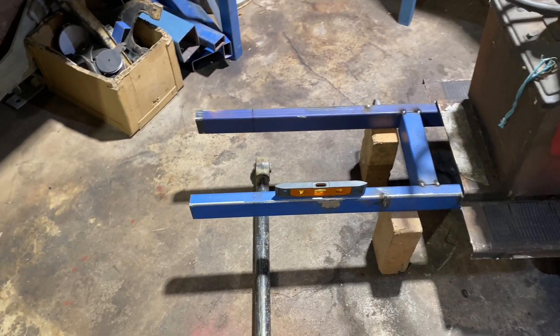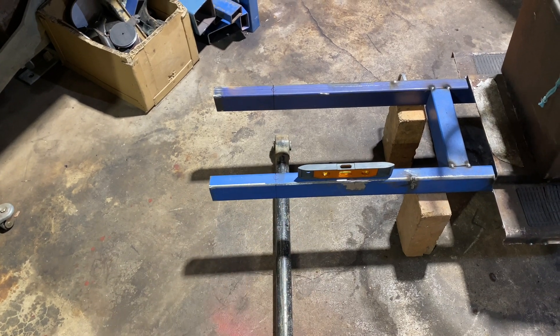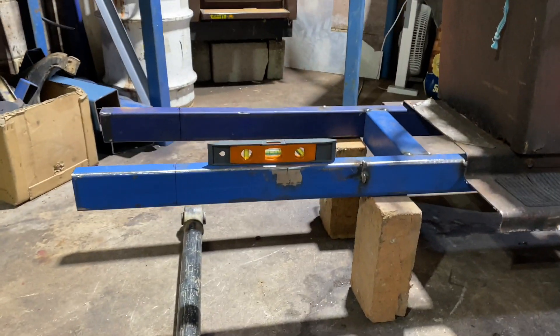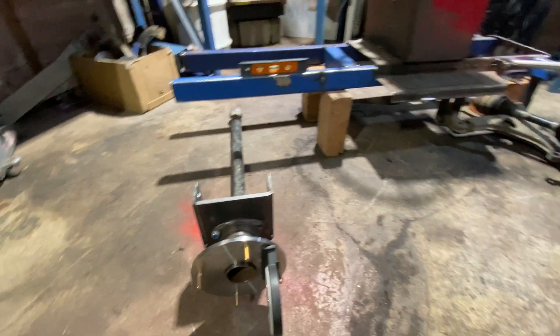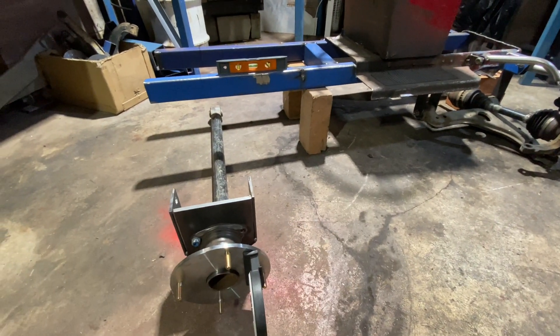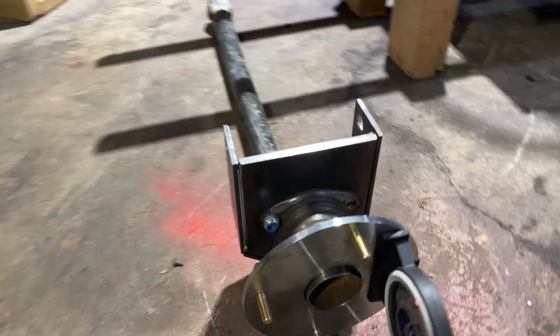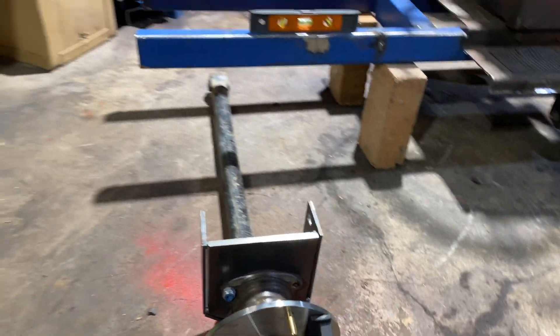What we've done there is removed that back section of the mower. I've centred a mark for where the wheel is going to go in the wheel arch of that back section, and we've levelled out the frame — it's nice and level. The floor has a crack right there, but it's about as level as we're going to get it. I've also made sure the hub is sitting at zero degrees, because this will be fully compressed suspension.